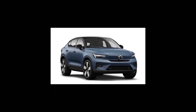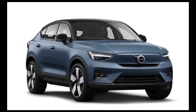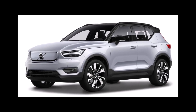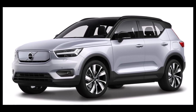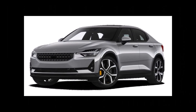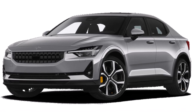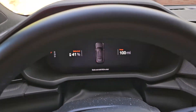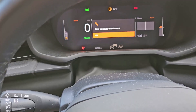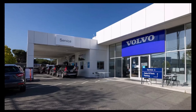Activate the vehicle with the external battery and charge your vehicle's battery for a few minutes. The vehicle being used should have its engine run at a slightly higher idling speed than normal, approximately 1500 RPM. The car should come to life pretty quickly, although it may take a few minutes to build enough energy in the EV's battery. Once started and the connections removed in the opposite order, the first thing to do is find a service center to have the start battery tested, charged, or likely replaced.